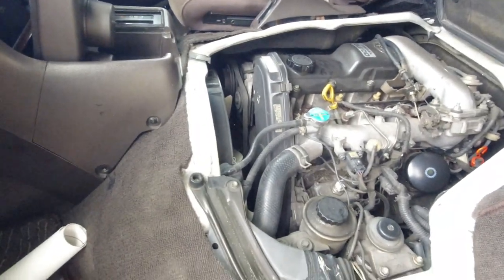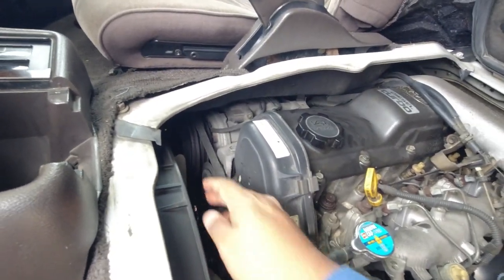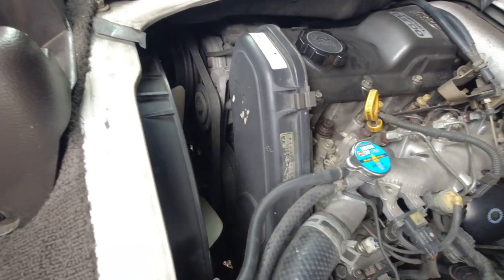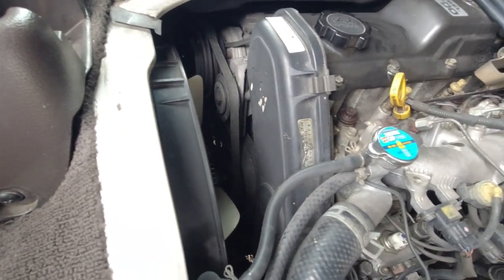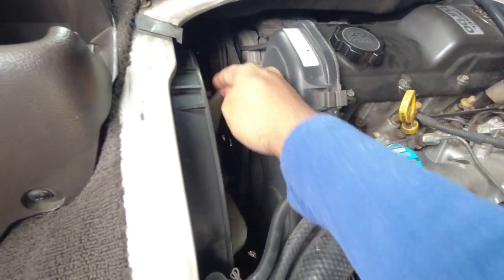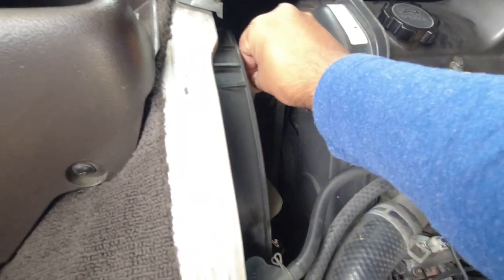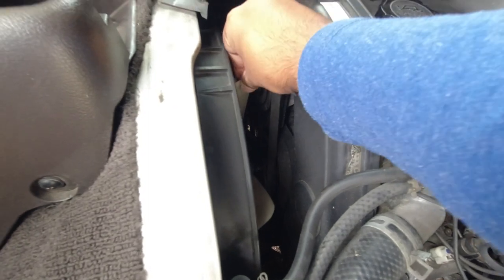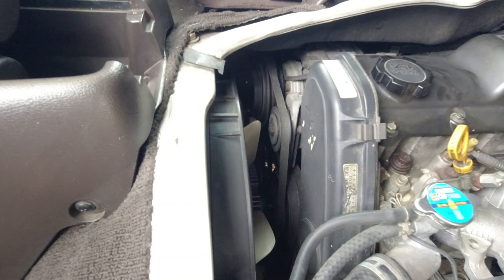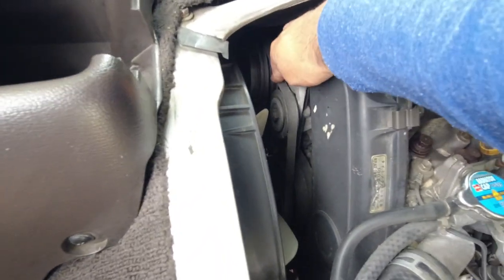And then finally in the engine bay, I'm just gonna give it a really good inspection. To test whether your viscous fan hub is working, what you do is you start the engine with the engine cover up, you turn the engine off, and if the fan stops instantly when you turn the engine off, it's essentially working. It should also feel nice and smooth, and you want to push it back and forth, and there is no noise or movement in that whatsoever, except for the plastic fan blade, which will indicate worn bearings in the pulley.